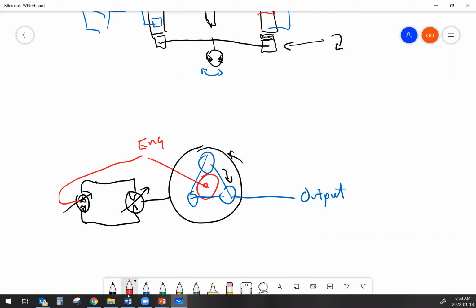Now, of course, the mechanical connection is a little more complex than this, but the idea of what's happening is exactly what I have drawn down here. This is how an IVT works, or a CVT. It really depends on whose branding we're talking about here, right? But a continuously variable or infinitely variable transmission. When you strip away all the other nonsense, it's a planetary and a hydrostat.